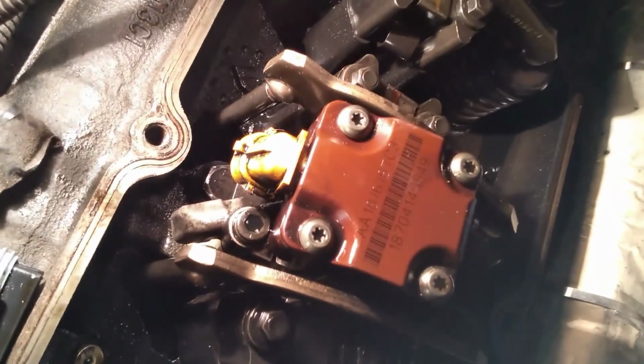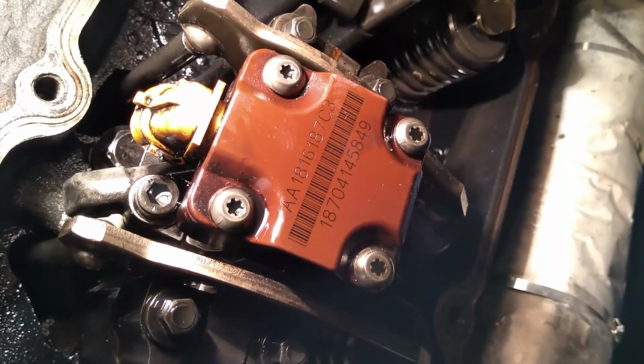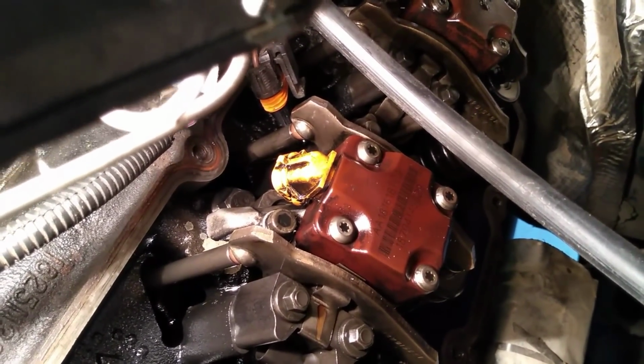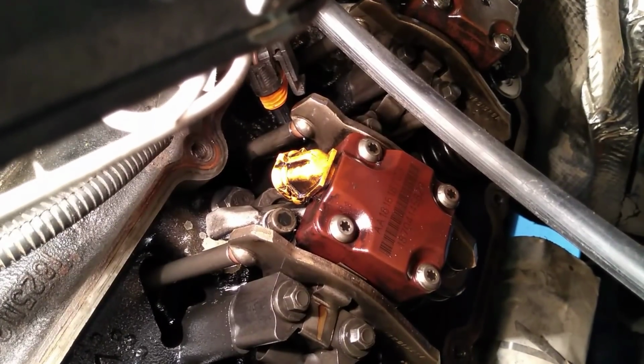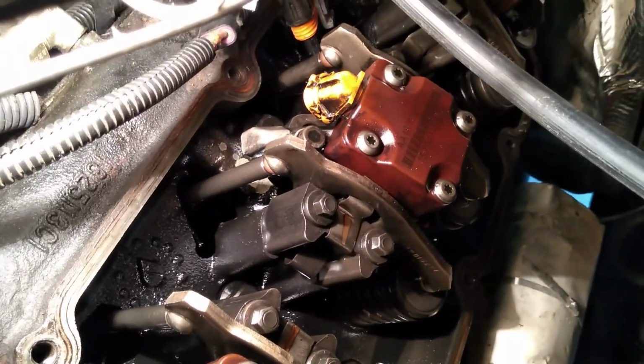Now for sure you can see a much better idea. There it is, double A, the name of those injectors, because this is an early model truck. This is an old body style 7.3 I've got here. And it uses the standard AA injectors and 90cc flow rate and with a single shot injection. But next up, we're going to need to drain the oil rail. Stay tuned.